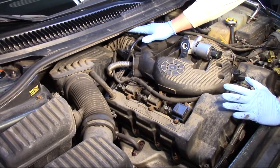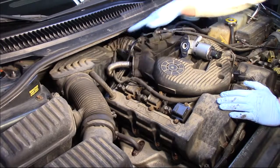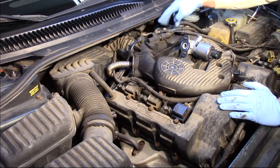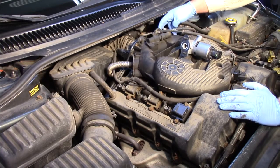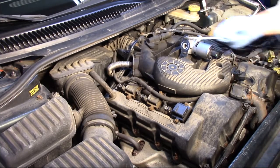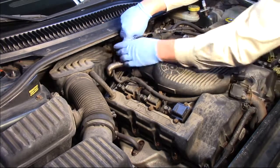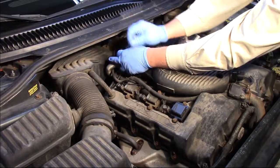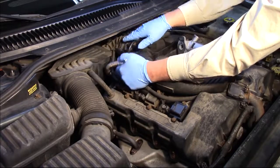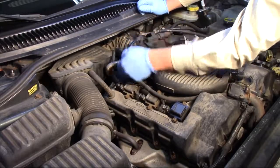In order to do so, it's going to be a little difficult to see on camera, but I'll do my best. We're going to have to remove the air cleaner, and then there are a couple bolts on the back side of each tube. On the driver's side tube, I'm going to have to remove the throttle cable bracket because it goes over the tube. I'll use a couple ratchet wrenches or sockets to break these loose, then pull the air cleaner assembly off for much better access to the back side.